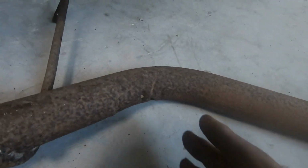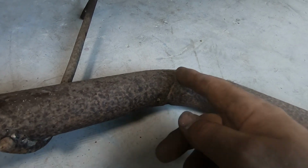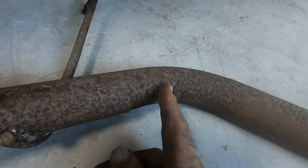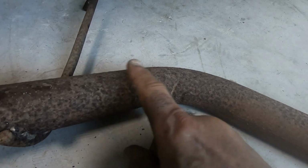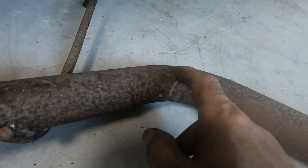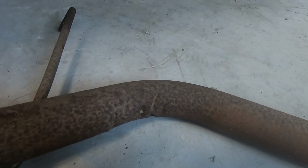So I'm going to do 2 bends first. I'm going to start with this one. And I've got no idea how to do it, or I've seen people do it. It's pie cuts. So I need to take a triangle out of there. The more triangles I take, the more curved the radius is. So what I might try and do is, I guess you go to center line.